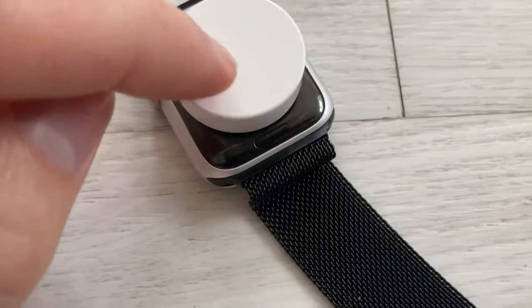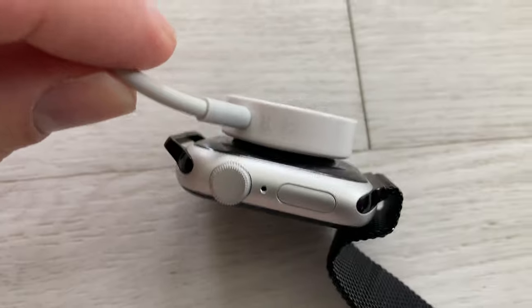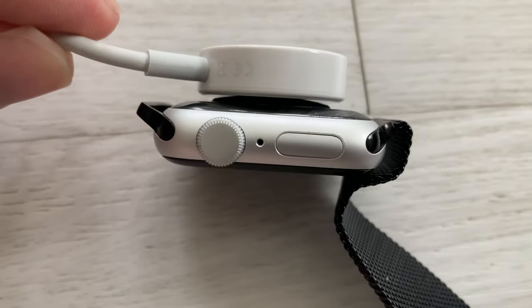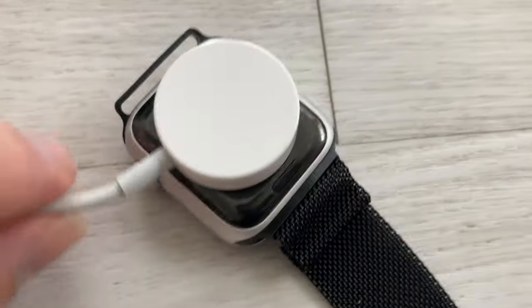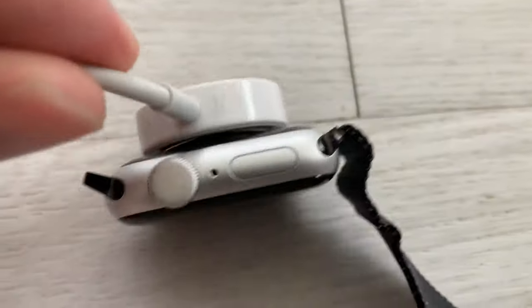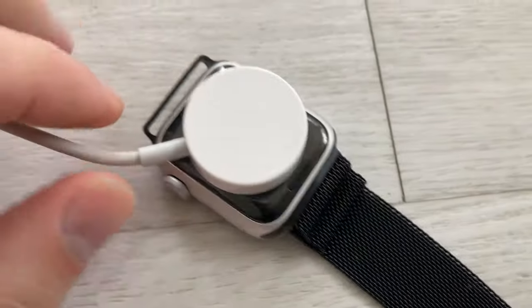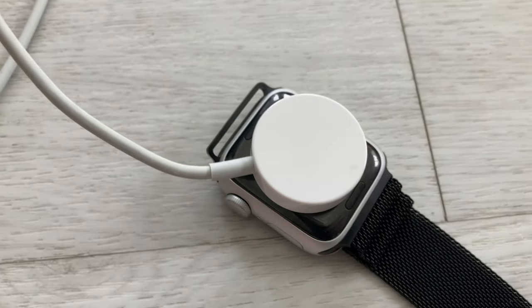the coil inside the white charging adapter is in close proximity and magnetically coupled like that to the crown back or case back raised bump that perfectly aligns the coils. And I can rotate freely. And what this does is it transfers current from the charging brick through the cable into the watch to accomplish charging the battery. Okay, to see what that looks like, we're gonna plug in the adapter here, like that.